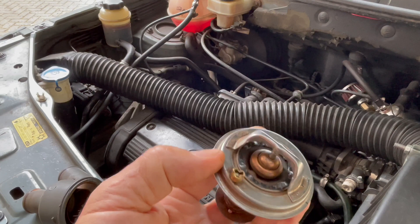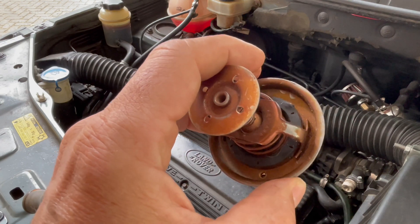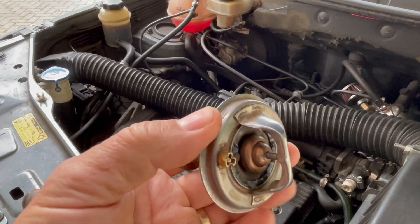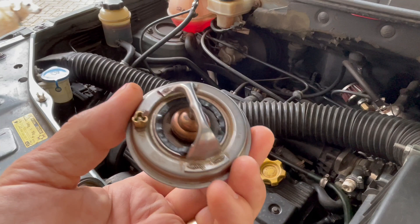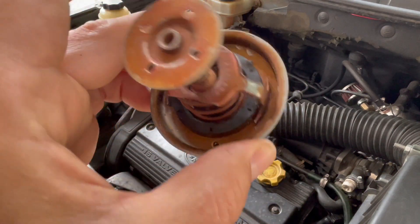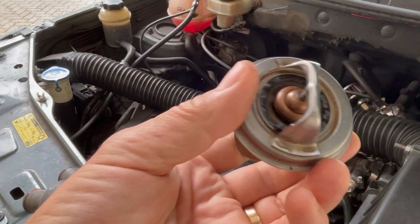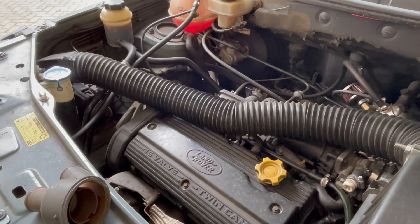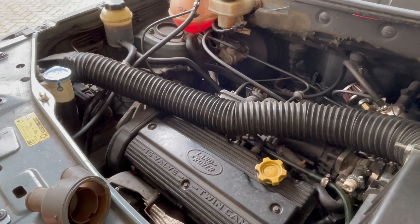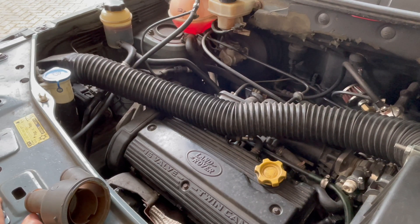What I saw was the temperature rapidly crashing from 117 down to about 60 degrees centigrade, and then after the next 10 minutes still idling it would creep all the way back up to 117 again. You might get lucky and the thermostat might eventually open because the water is so hot, or you might have to blip the throttle to force it open. Not a good situation, but something that is fairly easily rectified — and this solution has been working perfectly for the last year or so on this 1.8 turbo Freelander conversion.